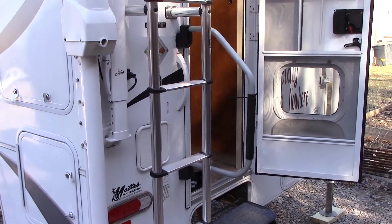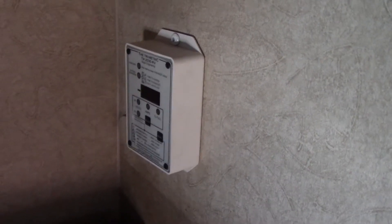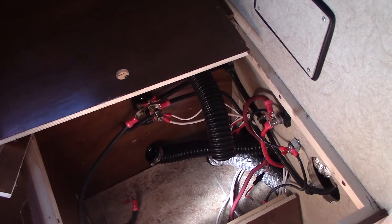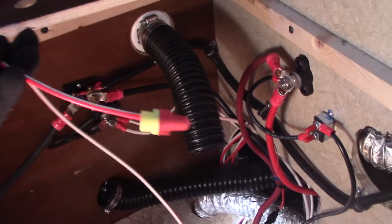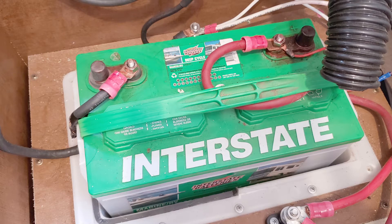In the Lance, the battery is kept inside under the seats in the dinette area. It's a pretty complex electrical system — there's a Trimetric TM2030 battery monitoring system, which is pretty cool. It uses a shunt to determine the capacity of the battery and can also tie into solar. I will be upgrading to solar in another video. This Lance 825 was completely pre-wired for solar — there's a connection on the roof and the wires terminate in here: positive line from solar and the negative is already terminated on the block.